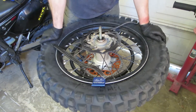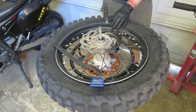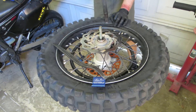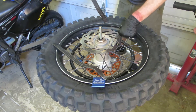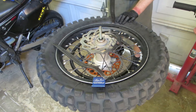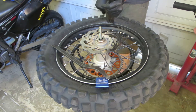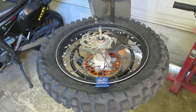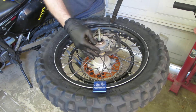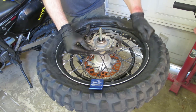I'm just making sure the tire is pushed down into the center of the rim a bit more. I'm pulling it back and looking inside. I think I accidentally grabbed the rim lock on this one, but I'm not fast-forwarding any of this — just showing you how I was struggling. I could see that I didn't grab the red liner, so I put a tire iron on the other side of the rim lock about the same distance away. I'm going to see if I can get both tire irons to pop the bead over, because if you can get that much bead over, it usually stays.